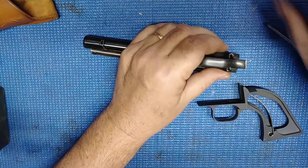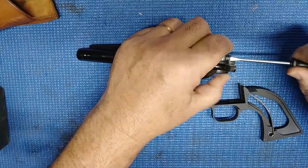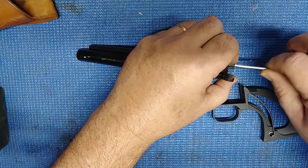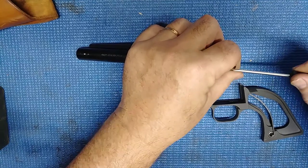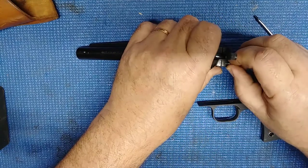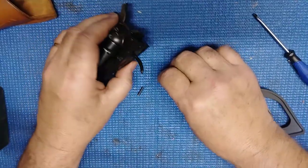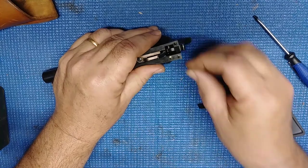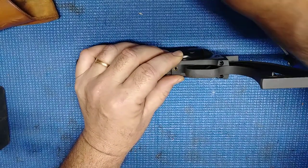And the third screw. There we go. Don't lose the little washers that are in there if you can — I'll try to save them. You do not want to lose the gate detent or the gate spring. Put them right back in place. Now just install everything in reverse with your new parts, starting at the front.